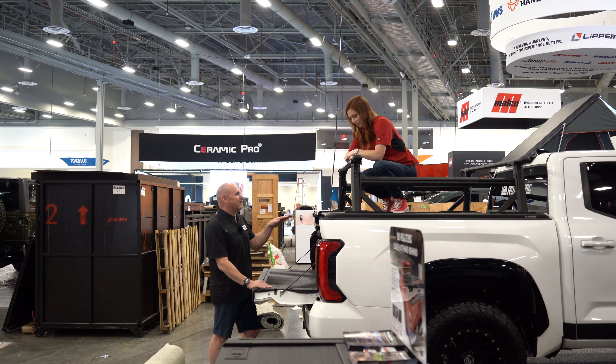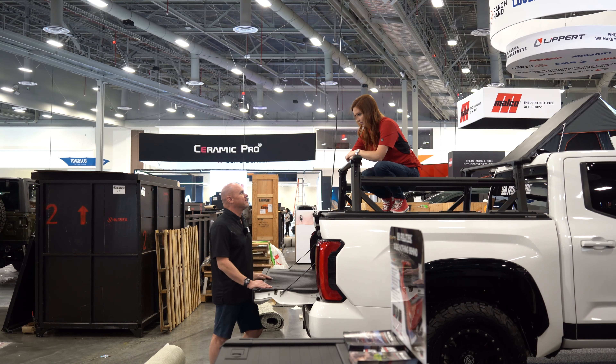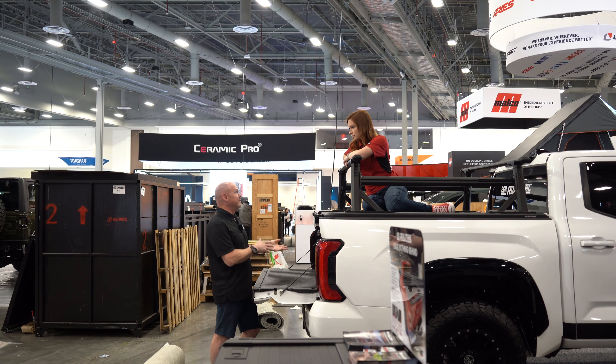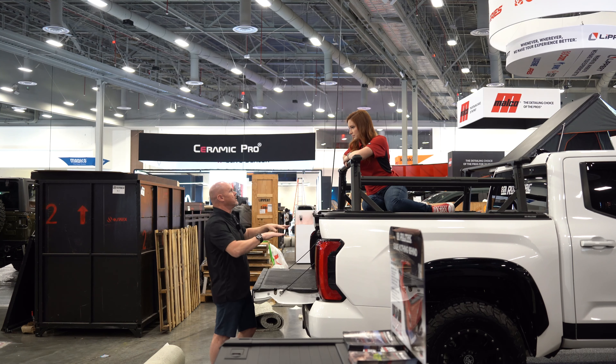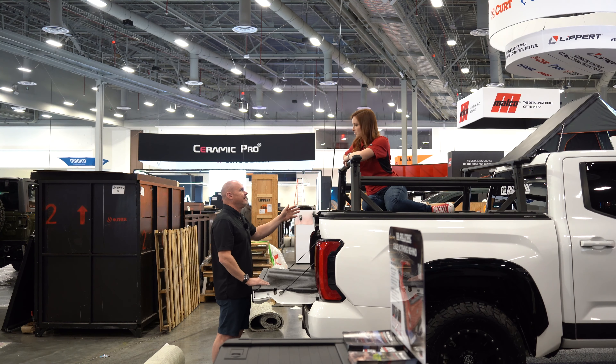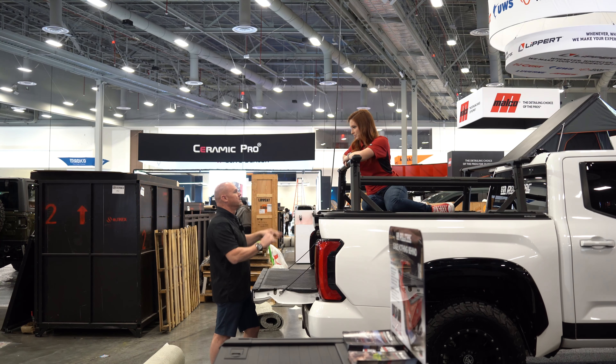And what about this rack? So our rack will hold up to 300 pounds dynamic, 700 pounds static weight. Can you explain what that means? Yeah, so your dynamic weight is going to be your movement weight, and static is in place. So when you're off-roading, you have a dynamic — your up and down, your motion. So when you put a tent on here and all your gear on this rack, it's going to increase the weight of your vehicle, as well as everything above this point. So with this rack, we can hold up to 300 pounds dynamic going off-road, or if you're just sitting still, up to 700 pounds.